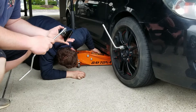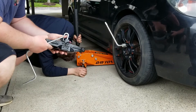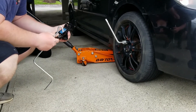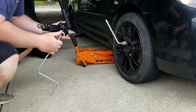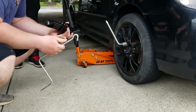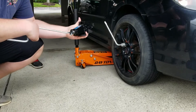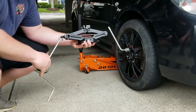Once you have your jack and everything up by the flat tire, you're going to want to get under your car and find a solid point on the frame to put the top of the jack and lift your car up. If you don't have a solid spot, there's a chance it may fall on you or not hold well. For the purpose of the video, we're going to use a better jack that's safer, but on the side of the road, this is what you're going to want to use. You hook it in and spin it once it's hooked up under the frame, and it's just going to lift your car up.